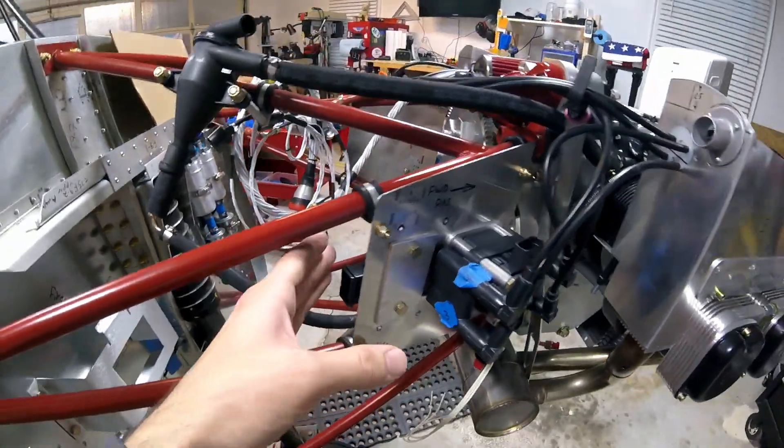I think that may have been some of the causes of some voltage regulators that were burning out, from some of the online research that I did. It could just be coincidental, but definitely wasn't good to have that gap there because that's a source of vibration, and you wouldn't get good heat transfer.